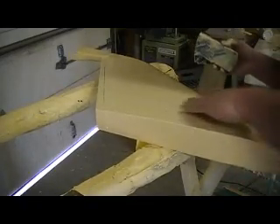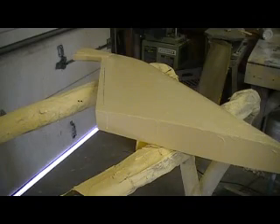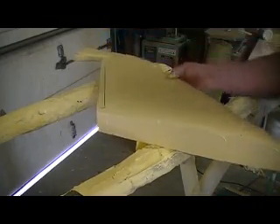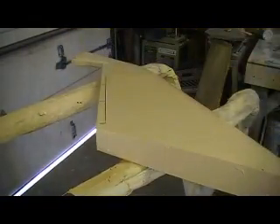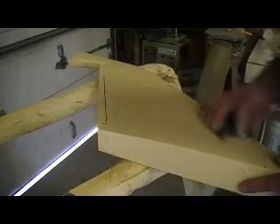I'm not going to have to prime this anymore. I just need to sand down to my tape — see what I'm doing? I'm sanding down to the top of my tape so that everything is flat across there. We want all that flat; we don't want the ridge. If you don't have enough primer on there, you'll have little ridges, and when you're priming and sanding your airplane, the panel lines will come right out if you don't get rid of that ridge and build up enough primer.